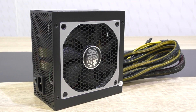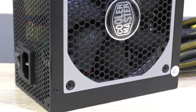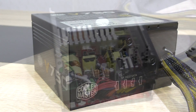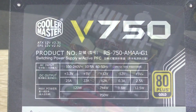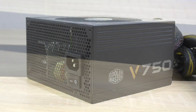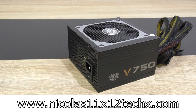Something I didn't like as much is the fact that we only get one EPS 12V cable and no additional PCIe cables, and that the permanently attached cables aren't braided very well — the ends on all cables except the 20+4 pin aren't braided at all. That doesn't affect performance, only aesthetics a little bit. But I'm glad Cooler Master isn't hiding anything from us — many manufacturers make their PSUs look expensive outside while the internals tell a different story. Luckily Cooler Master lays its cards on the table. Long story short, the V750-SM is a very solid PSU with great performance and stability — a unit you can simply trust — at an unbelievable price of just $110 to $115. I can definitely recommend this Cooler Master V750 Semi-Modular 750 Watt power supply.